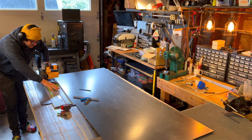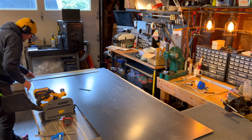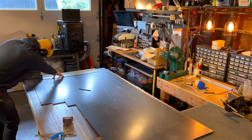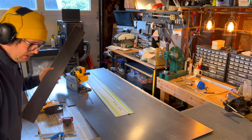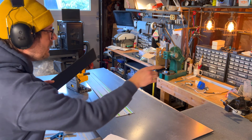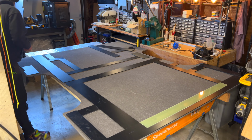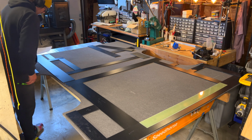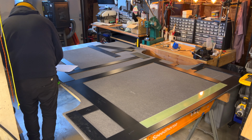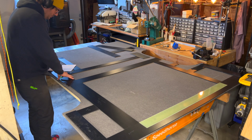After I finished the L-track cuts, I moved on to cutting strips of 1/4 inch expanded PVC. This is a pretty inexpensive, rigid, decent R-value plastic that will serve as an intermediate structure in key areas under the floor, allowing me to put one more layer of mini cell foam that won't be compressed. Think areas like under the joints for reinforcement, under my cabinets, in areas where there are no floor ribs, and where the factory bolt hole locations are.